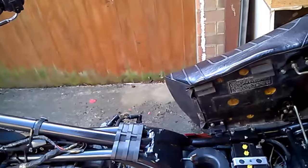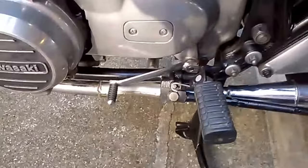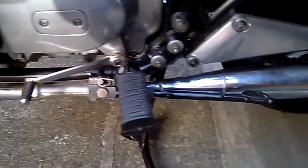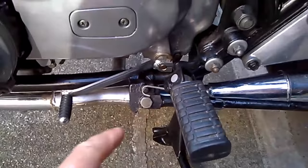Then it dawned on me - the operation of that circuit is contingent upon some other switches on the bike. Most commonly that's a neutral switch, so the bike has to be in neutral before the engine will turn over. That's what it's like on my CBF here. The other common thing on more modern bikes is a kickstand switch - a switch in the kickstand so the bike won't turn over until the kickstand's up.